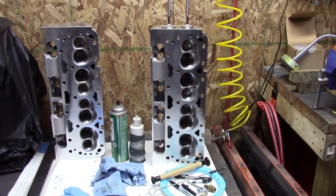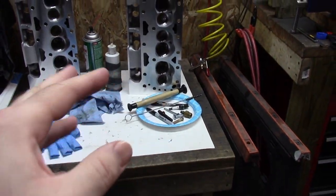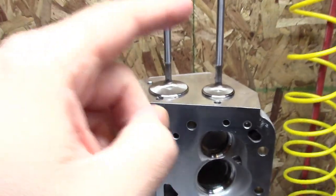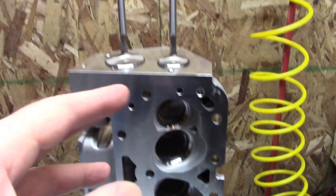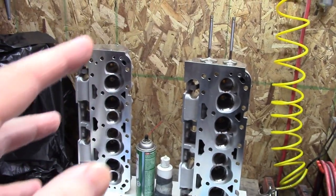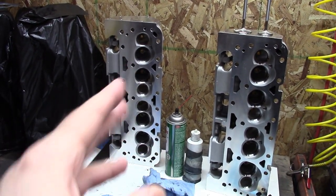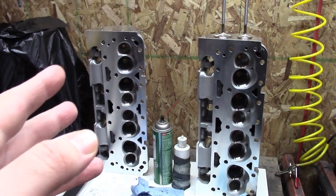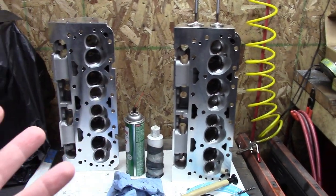The second head checks all good. It's flat, all threads check, the seats are right as they should be — good contact patch. That is a 1.6 exhaust valve, machined for the correct valves as advertised. Everything is great. This is how things should go. There's that one minor flaw — the thread on that one head — but that's no big deal. That's a center bolt valve cover thread I'm probably not going to use, but I'll fix it before I put it together anyway. These heads are good — couldn't be happier, they're as advertised.